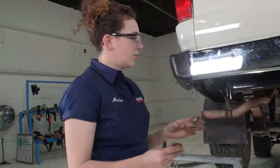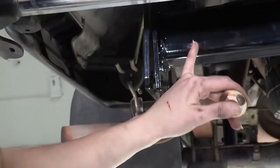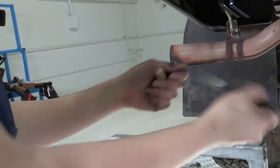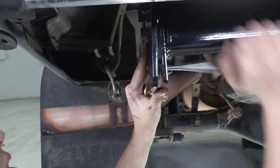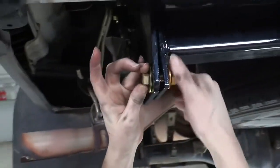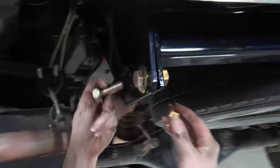So now we're going to put our hardware on the driver's side. If you're having trouble lining up the bracket and our center tube here, you can loosen any of the horizontal hardware we put into the frame earlier, or you can use a line-up tool. If you don't have anything like this, you can also use a sturdy screwdriver or something like that to get your holes into position. Now we're all lined up and we're going to use the same hardware that we did on the passenger side and get that snug on there, then put the other two bolts in.